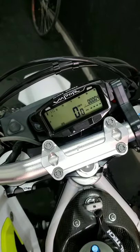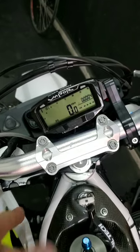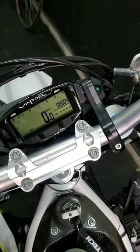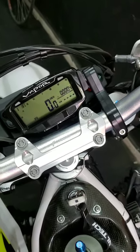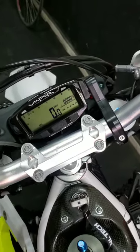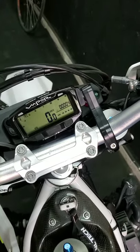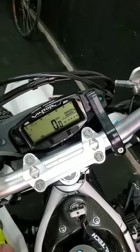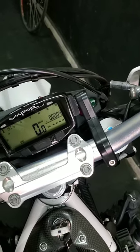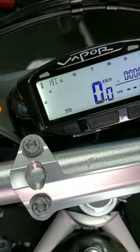As you saw when you start the bike, the tachometer will go a little bit crazy and spike up to 12,000 RPMs. From what I researched, this happens because with only one wire from the coil to the RPM sensor it won't be accurate at startup. Sometimes the bike also gets erratic on the RPMs, but this only happens for the first five seconds. You can also see the bike temperature reading here.